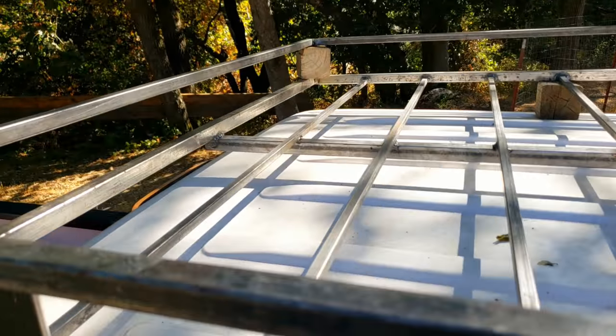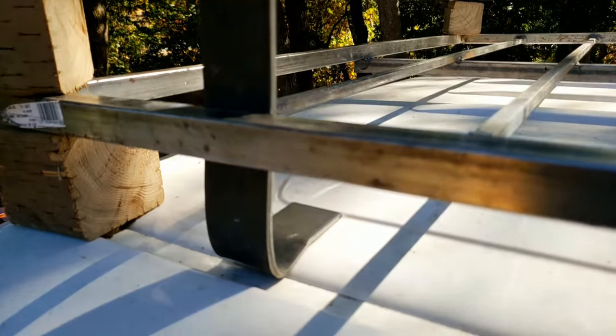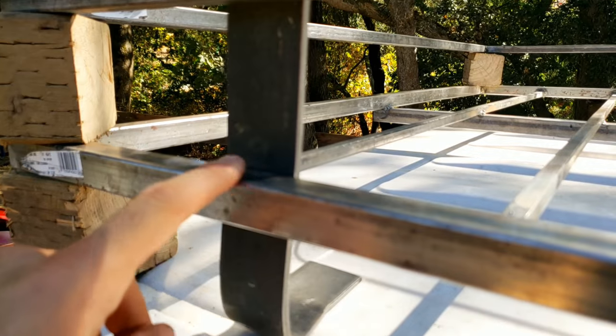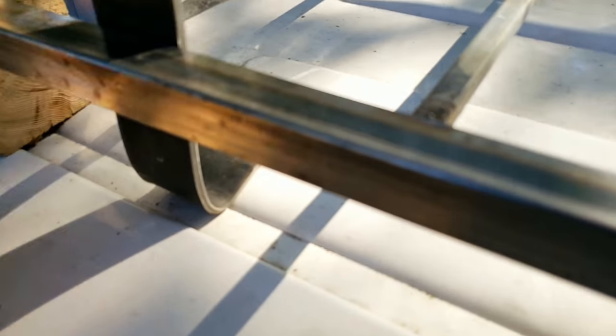Today I'm working on getting the roof rack mounted to the truck. I've decided I'm going to do it all in one piece and I'm trying to contour it right now to fit right on the roof line, then connect to both the top and the bottom piece and weld these in. I'm going to run two carriage bolts down through here and put a nut on from underneath, so you will not be able to remove the rack without being inside.